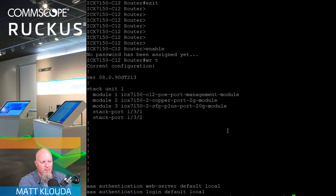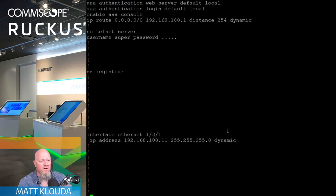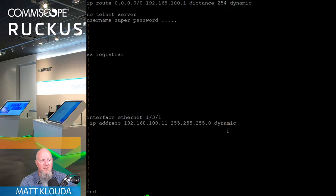One thing I want to point out as you look at this is there's no config on this guy. I mean, it pulled an IP address from the cable modem that I plugged into it. You're never going to know what this IP address is unless you have console access. Andrew can speak to that. He fought with this last week. He had to go buy a cable, get plugged into it, get the IP address, and now he'll be able to set a static IP address on it so he can get back into it whenever he needs to.